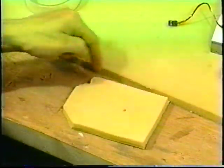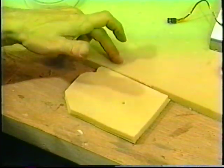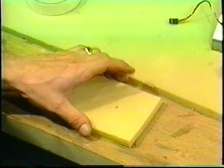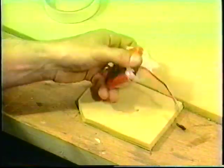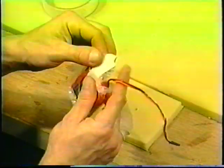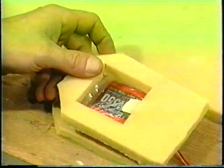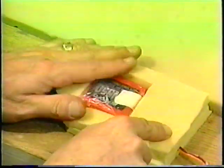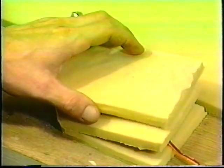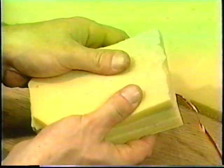I've cut some foam the shape of our whole fuel tank compartment — this is about 9/16th pad, same as carpet pad, and any foam will work but the foam about the thickness of your item is best. We cut out a section the same size as our battery and put that in, then lay another piece on top. This creates a little sandwich that holds our battery, totally shock-mounts it so we should never have a problem. It's a nice neat installation and will also give us a nice bed for our fuel tank.